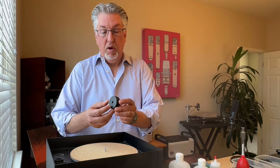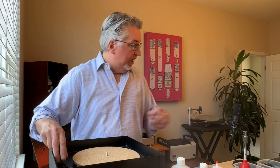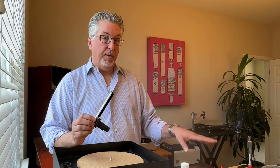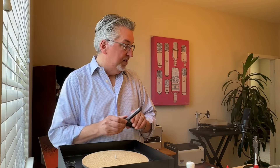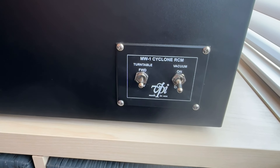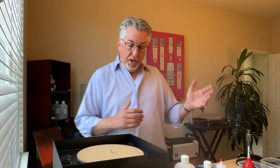There's a screw-on clamp with a threaded spindle — very important, because without it your record will just spin around and potentially be damaged. The machine also has a small spring on which the wand and column rest. We recommend having two wands: one for the record cleaning fluid and one for the pure water rinse. There are two knobs — one to turn the platter in a forward or reverse direction, which is one of the nice things about the Cyclone, that bi-directionality really helps the cleaning process — and an on/off switch for the suction motor.